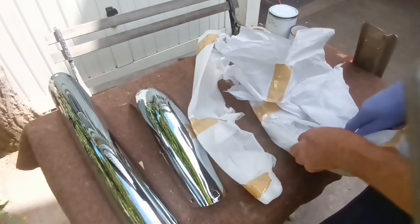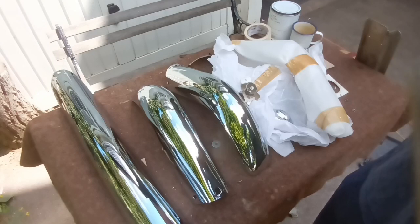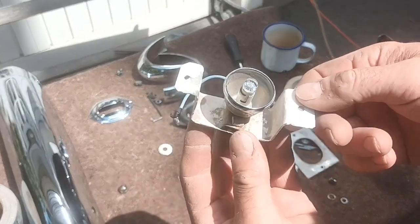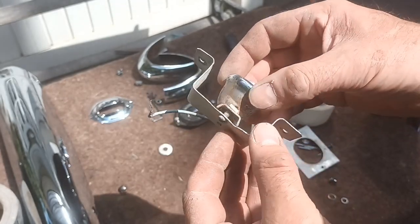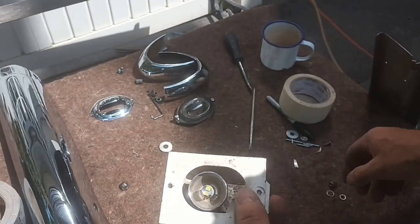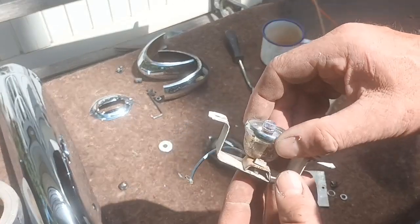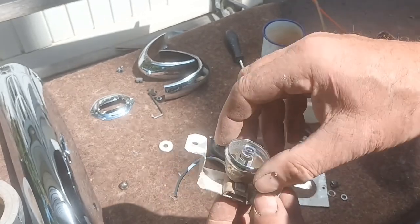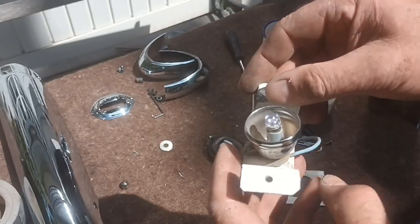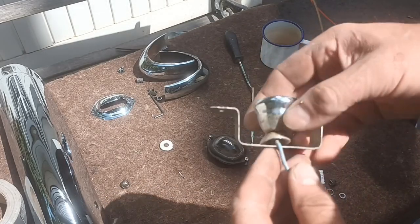Let's look at this one. So this is what I've inherited. That's a new LED bulb and I presume that's sort of original. The chrome bit on top — I don't think that can actually twist where it is because the rubber is going to hold it in place. But I don't like that wire going through that hole with no grommet, so let's see if I've got a grommet I can put in there, and put a longer wire on so that the connection is inside the boot rather than outside under the bumper.